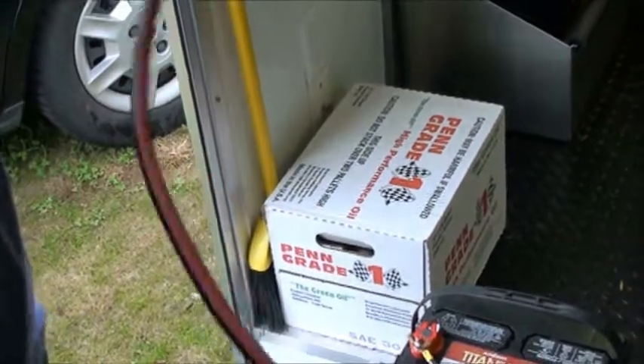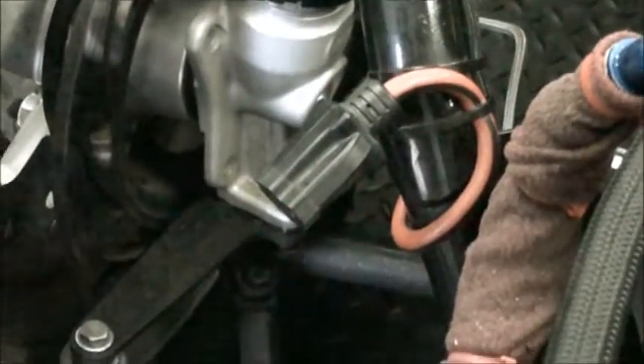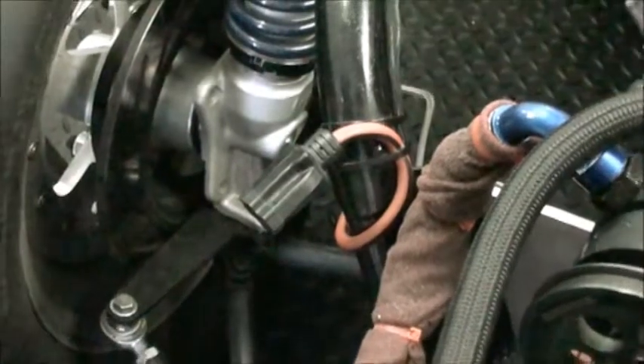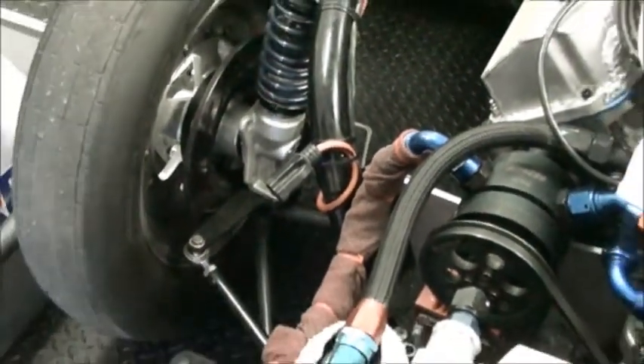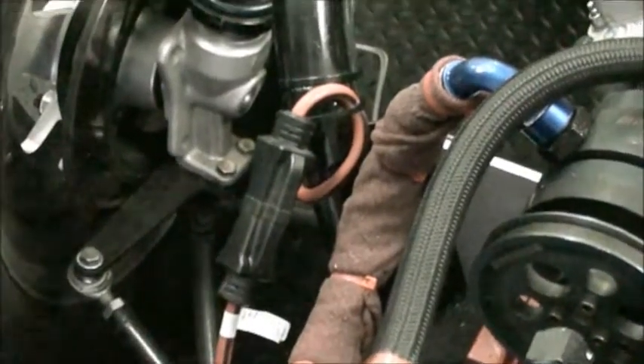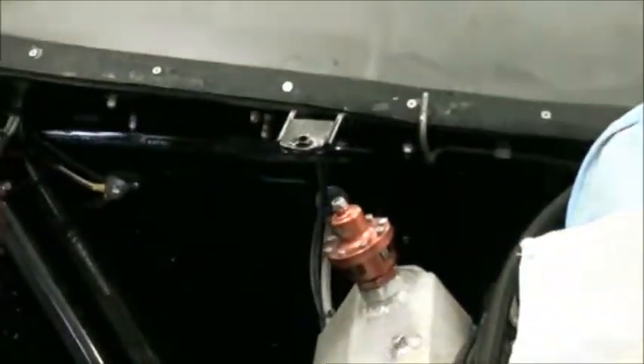Now we're going to go over to the car and I'm going to show you how you hook it up. After we make a pass and get back to the trailer, the first thing we do is cut the power off, then hook up the 16-volt charger and start charging immediately. Since the master cutoff disconnects the battery, nothing else in the car has voltage anymore. So that allows us to come over and plug up our extension cable. Those two hot wires go to the terminal on the firewall — we're going to zoom in so you can see it. That pass-through is where we pick up main power for the starter and for all other devices on the front of the car, such as the fuel pump, the water pump, and the fan relay boards. The ground terminal then just goes to a good solid chassis ground.